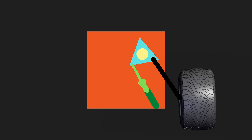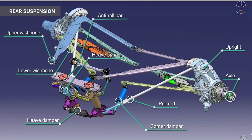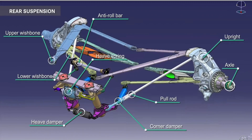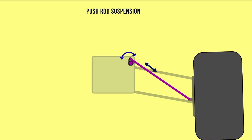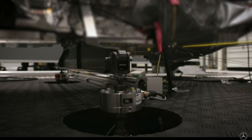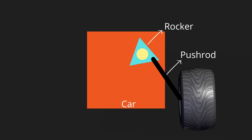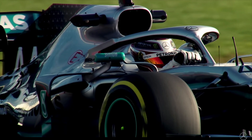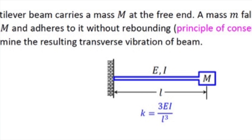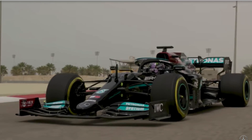As the wheel is pushed upwards, the rod pushes the rocker, hence the rocker rotates. For pull rod, the rocker is mounted at the bottom of the car, so when the wheel rides, the rod pulls the rocker around the fixed axis — this is a pull rod system. The goal of the rocker is to turn linear motion into rotational motion, to ease packaging. The linear motion of the wheel is translated through the rod and the rocker translates that into rotational motion. Now we add a damper here — the upward motion of the wheel is translated to circular motion by the rocker, then that is translated to linear direction through the damper.